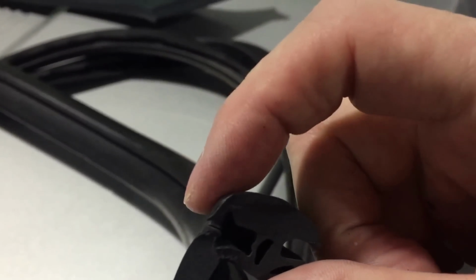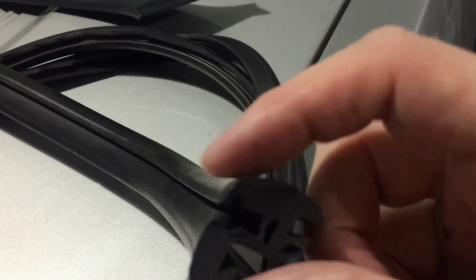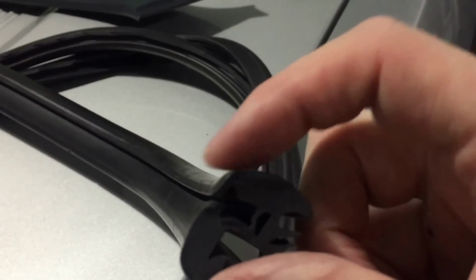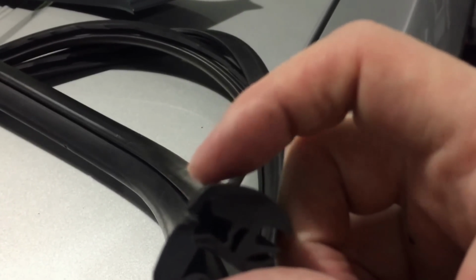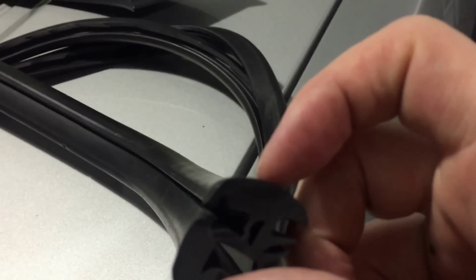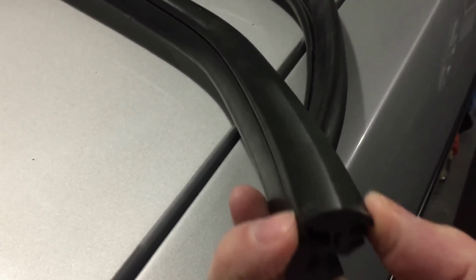So I'm now starting to think I don't need to worry too much about having the glass at the wrong height relative to position. It looks like by just drawing my thick bead of urethane and plunking the glass onto the urethane, it's going to set up at the right height that it originally was, and that little trim piece over there is going to be fine. Nice. It's actually a little narrower than this. This is probably more like 24 versus 17, but the glue-in glass is wider.